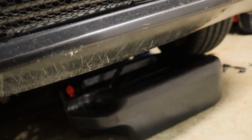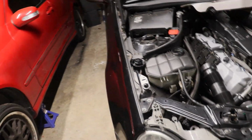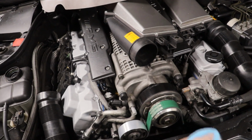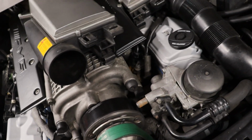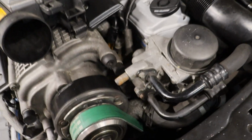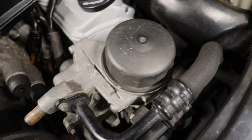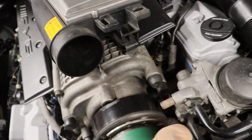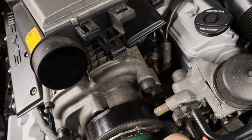We've done our drain. That sounds like it has stopped, so I'm gonna go ahead and tighten up the petcock. And the way I do this, guys, is basically just fill up the system and burp the hoses as much as I can. M113K is a little different here. You don't have quite as much access to your hoses here. And there's also, looks like a plastic fitting in the center of that one, so it's going to be a little hard to burp just this one little piece.